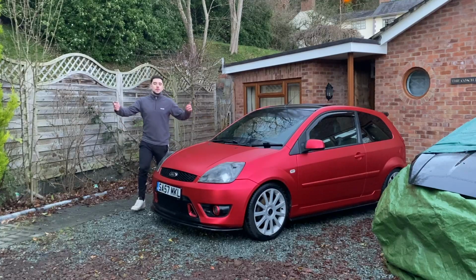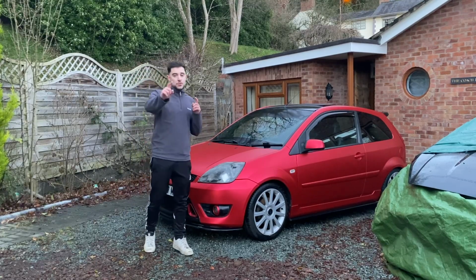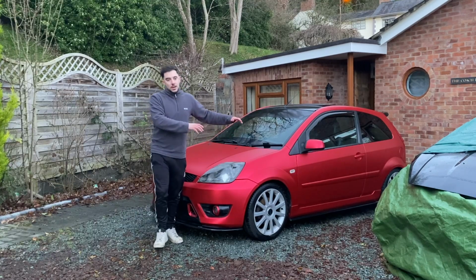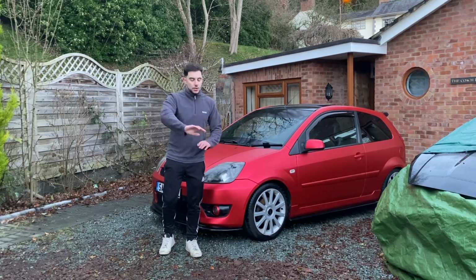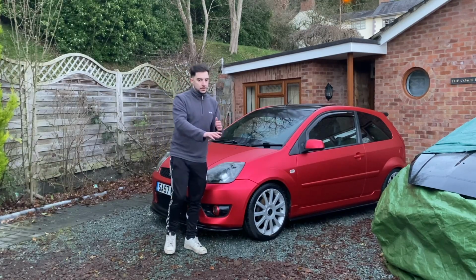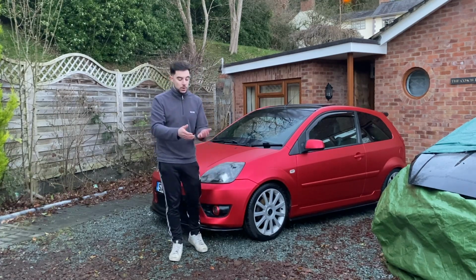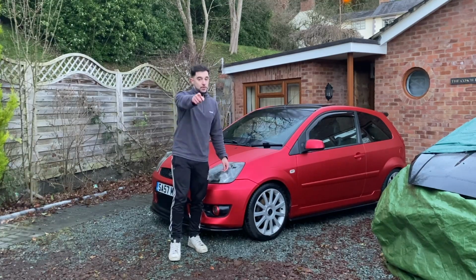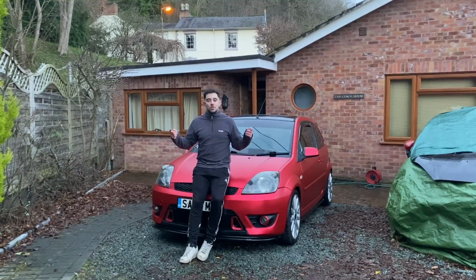So maybe now you're inspired to go and do this yourself, or maybe you're thinking you just don't want the hassle at all after hearing what it was like for me to do this. One other thing I just want to mention before I go, I nearly forgot, is that with this brand of vinyl that we bought and used for this car, I did find that if you've watched wrapping videos before and you see people just squeegeeing out air bubbles nice and easily, you can't do that with this brand that I found. It says it has the air release liner on it, but I found that it just didn't work. You couldn't use a squeegee to flatten anything out. You were just going to put more creases into it. So that was another reason why the wrapping gloves came in really handy, because we were having to smooth everything out by hand rather than using a squeegee. Just thought that was worth mentioning if you were thinking of doing this and thinking of going for a cheaper vinyl like I did.